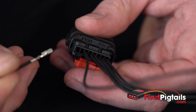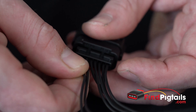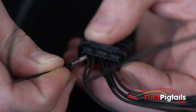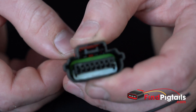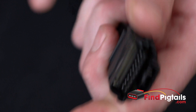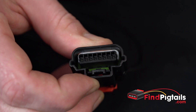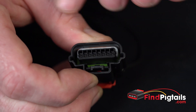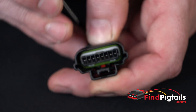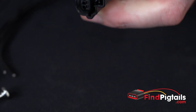Slide this pin in — I'm going to push it until it clicks. Same deal on the last one: slide it in right into the front and it locks in position. Once you've got all your pins reinstalled, do a little pull check on those wires. I'll visually check the pins just to make sure they're all up to the front and all the catches are holding. Once you know everything's good, push your lock down, make sure it's secure, look at your gap through the front on that latch, and once everything's good you're ready to rock.